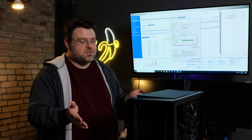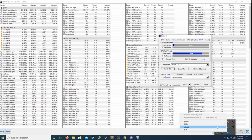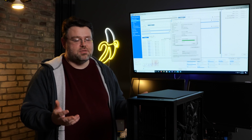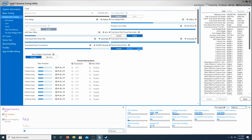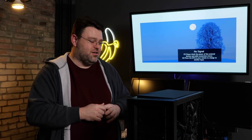There are other little annoyances with the Intel software too, other than the ones that I've already mentioned. Like if you have cryo mode turned on and you need to reboot, well, it'll remember the overclock in the Intel Extreme Tuning Utility, but it doesn't necessarily reapply cryo mode until the software loads. That's incredibly dumb. The software should have a feature where it's like, just run in cryo mode all the time. I mean, I know the whole dew point thing, and maybe that's a concern. Maybe don't drop it down to like 16 degrees C, just drop it down to like 45 degrees C when the software's rebooting. Because you can totally have a stable, safe overclock, but then sometimes it'll just shut off, because it's not completely, perfectly 100% stable, but it's pretty darn good.